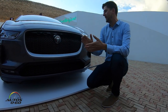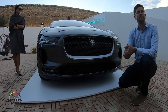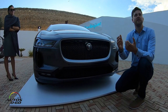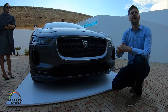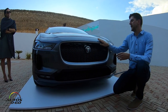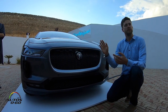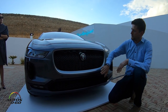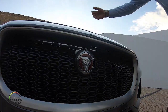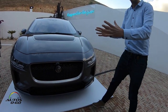I'm going to talk about aerodynamics quite a lot. During the design process we had an aero team working closely with us, because aero efficiency in electric car terms equates to mileage almost one-to-one. We set a very aggressive aerodynamic target of 0.29 Cd, which we achieved through a number of features — one being where the air comes through the grille and goes up over the bonnet, coming straight out through the bonnet and up over the roof, staying attached and keeping the air very clean.